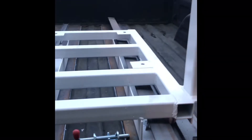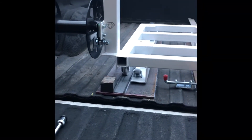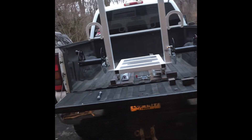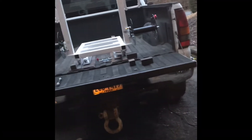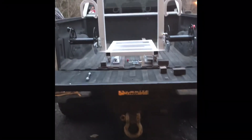It's coming along. I don't know if I want to be out here tomorrow — it's going to be like 28 degrees for a high. I got so much work to do. I got pieces of angle to put a cross underneath the bed for support since it's a little rotted out. I got new bed cross members, all new. But I'm trying to wait until the summertime to take the bed off and take my time putting the cross members in, paint it down with Por-15, paint the frame with Por-15. If I can get temporary cross members in there, it'll be good enough.